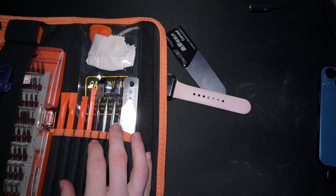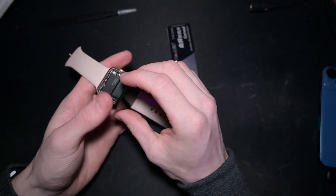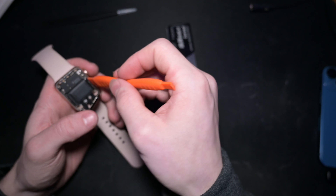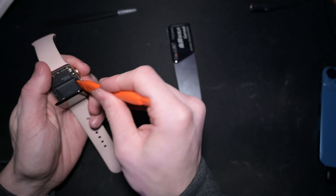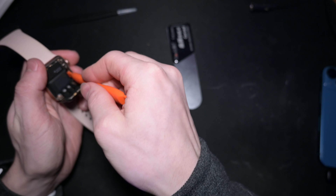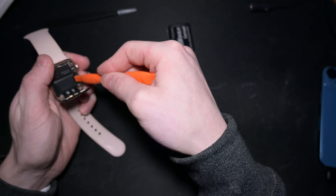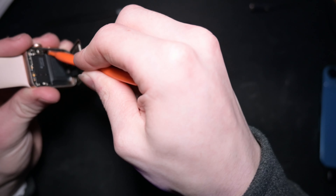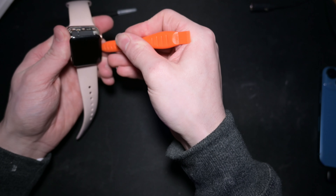Because I know how hard those are to take off. The good thing is the adhesive is actually decently new. I think I'm able to do this without taking the screen off. Just be careful so you don't puncture the battery. Be careful of the screen, don't knock it off. Make sure you can get to the bottom and then pry — you're not prying onto the side of the battery. The adhesive is actually pretty fresh.